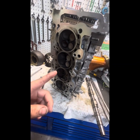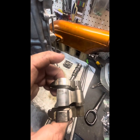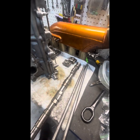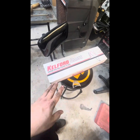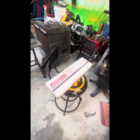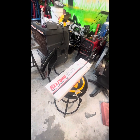Because of that, the head starved, took out my cam, and took out some rockers — you can see my rockers are ruined on the small pads. So I got some new rockers, I got some new cams. Going with the Kelford 184T. They're big boys. I'm doing some upgrades while I have this thing apart.